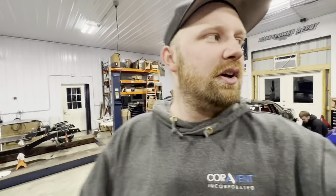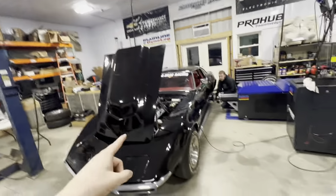Need to get our logs and all this information sent back to the converter company and see what they want to do from here. Possibly get another stator that's tighter. This one should have tightened up a bunch, and it actually didn't tighten it up hardly any, if anything, like less than 100 RPM. So we're getting it off the dyno right now.